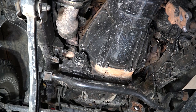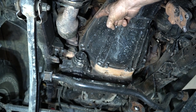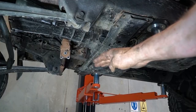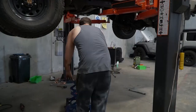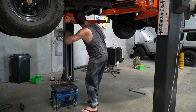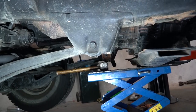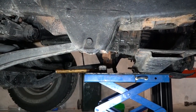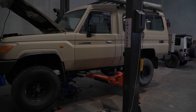So all of these bell housing bolts get harder as you go around — these are the easy ones, it gets more difficult around the side. The ones up top are a bit of a contortionist exercise and there's not enough clearance to swing at all, so I'm going to have to lower the back of the gearbox a little bit to give more clearance on top, which is probably not ideal. Let's see if it works. I've got a nice angle on the gearbox now and I should have a lot more space on top — about that much. The only downside is that I now have to crawl on my back like a peasant to get those last two bolts.